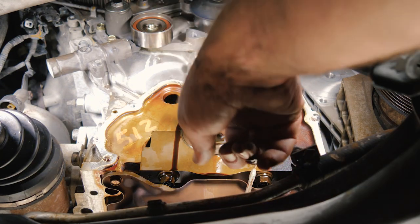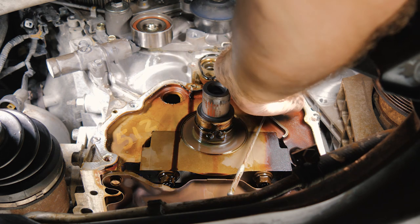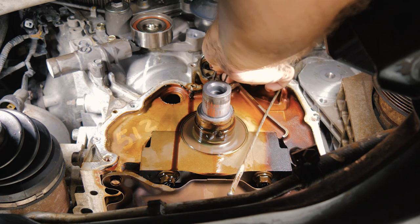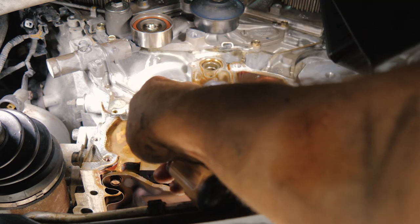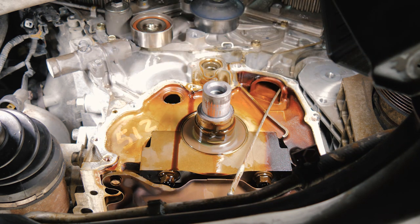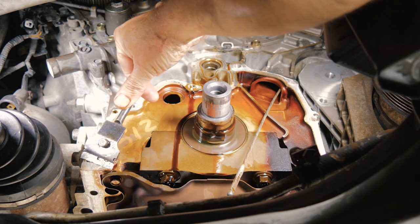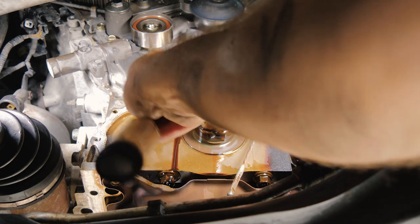And this is our dipstick. Go ahead and pull that back up before we put the new piece on. We got our gasket. This is our old gasket material. We want to go ahead and clean this up. I've already done this on the oil pan and the oil pan mounting surface. So we want to clean this up, and we're going to spray it with some brake clean, get all the oil off. That way our new RTV will stick nicely.